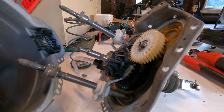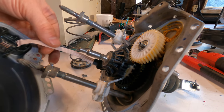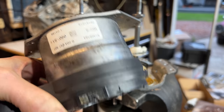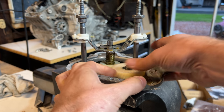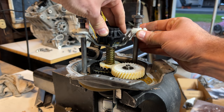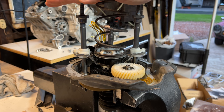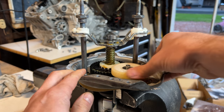This sensor that measures the movement goes to this connector here on the bread pan — at least it normally does. Mine ripped apart when the spring decided to yeet the bread pan off the top. So the sensor sees that you are pressing the brakes and knows how hard you're pressing, so it helps you by spinning this motor. This in turn spins this gear, which spins this gear, which moves this assembly toward the brake master cylinder, helping you press the brakes. When you let off the brakes, the sensor moves back, the motor stops motoring, and the whole thing returns back to where it started. How does it return back? Well, you remember that big-ass spring that exploded this whole thing apart? That spring. This is all back-drivable, so you don't need the motor to be turning forward and backward — it can just turn forward.